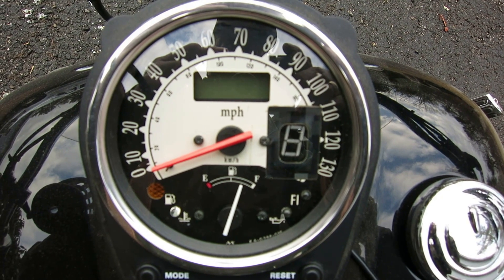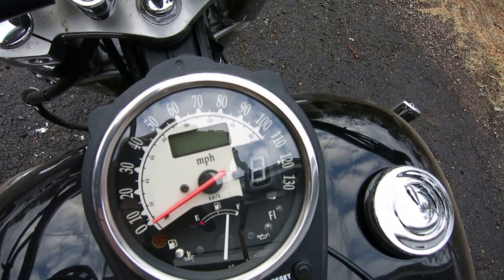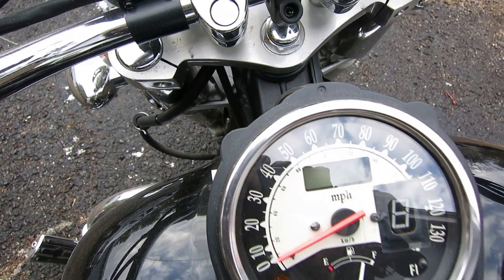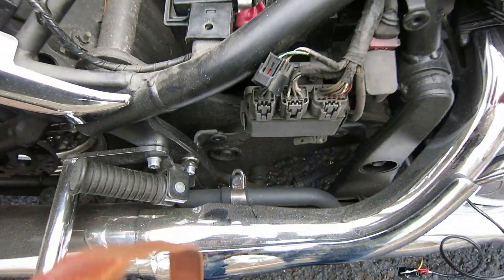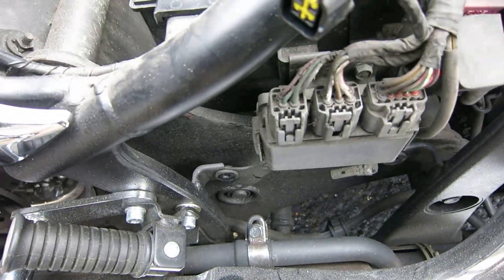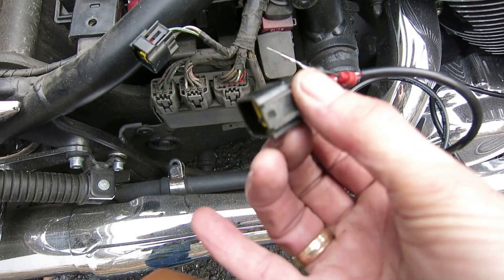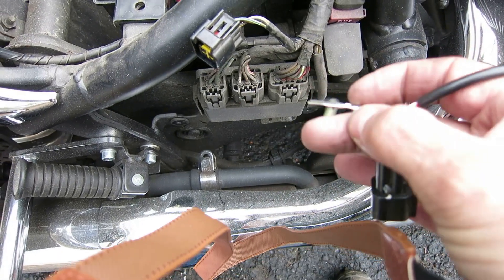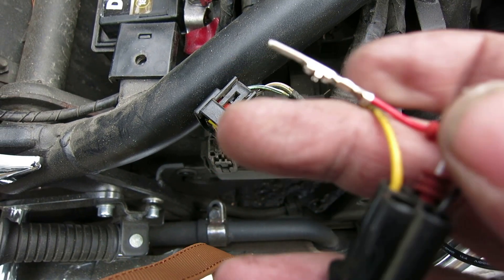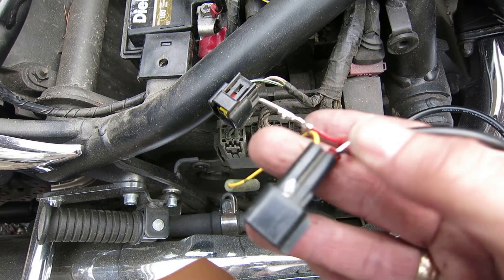You can see I have the selector installed on here now and we're just making sure that it works — let's turn the key on. You've got to find your OBD2 connector; on this particular model, a 2008, you have this connector with a little yellow wire hanging off of it. You need to take the three wires — they give you a connector but it doesn't fit, so you use the connector that was on there and figure out which wires go where: white, black, and red on the bottom. You'll have to fold those little tabs over and slide the pins in to snap them in place.